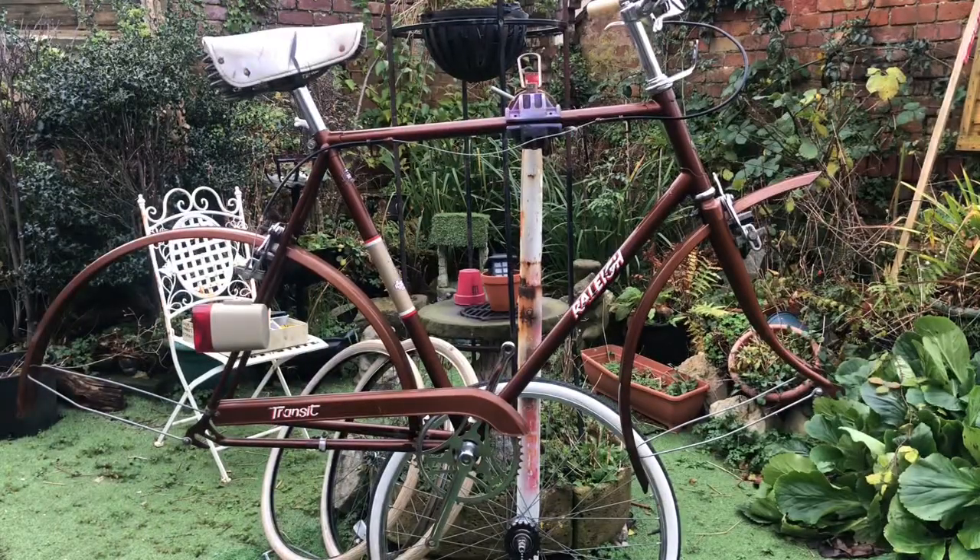There we are — a nice little clean. I decided against clear coating in this instance. It's a metallic, it's dark — clear coat would maybe add some sparkle to it. It's also very original and there are a couple of tiny little scuffs in the top layer which a clear coat might take out, but I think I'll leave that choice to the next owner. It will need a wipe over with white spirit before clear coating because it's now got silicone polish on it, but apart from that it's the next person's choice. It's looking very nice even though the camera isn't really picking it up.